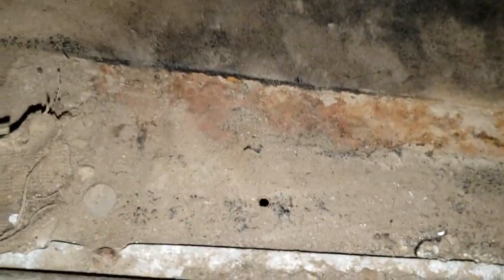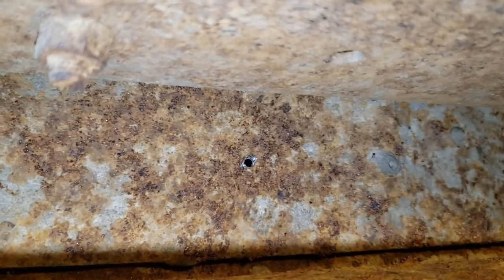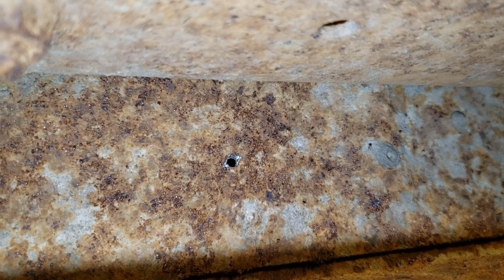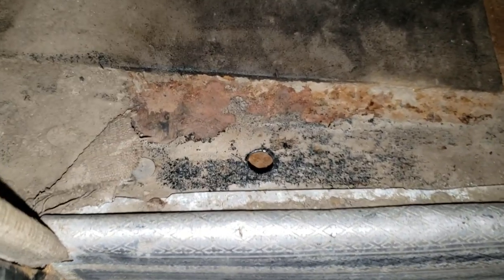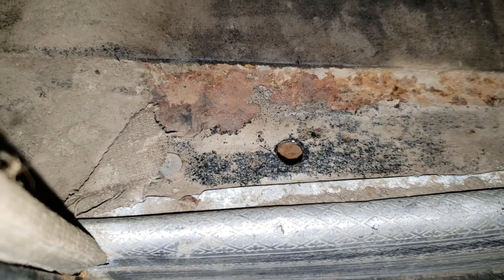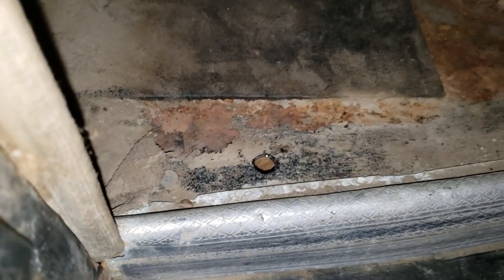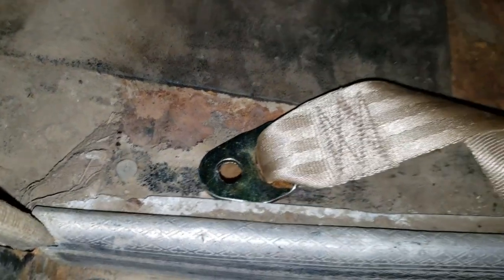I ran a test hole first. Underneath, you can see it gave me enough room and a nice flat surface to get that big fender washer underneath — flat and secure. So my next step is to drill that hole bigger and actually mount it. There's the full-size hole. I didn't film the actual drilling — this is an original car and it's very difficult to drill holes in it — but for safety it's very important to get these seat belts in. Looks like I have enough room to put the bracket through and get the washers installed.